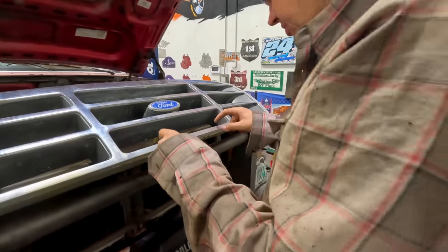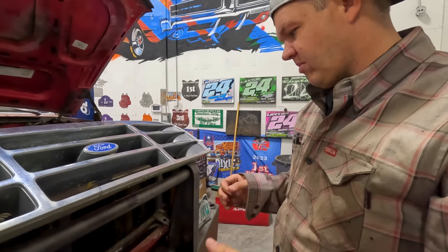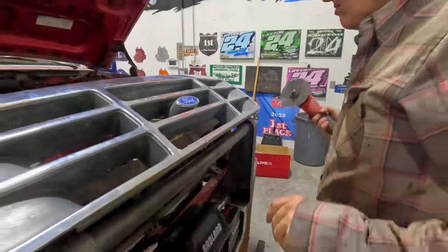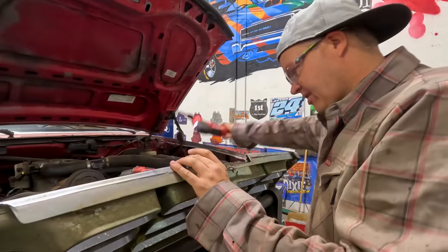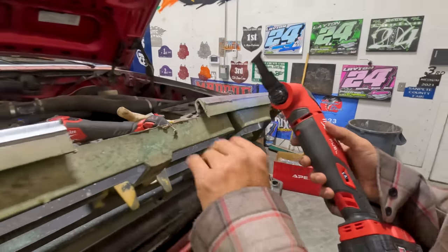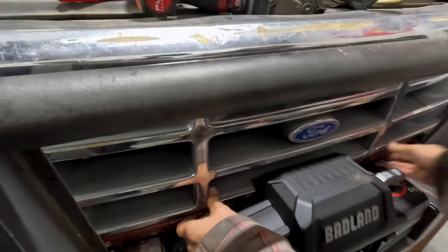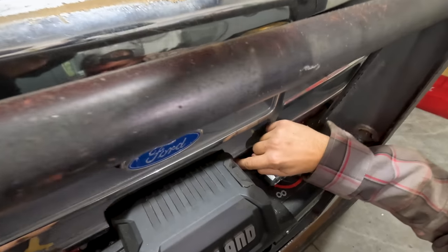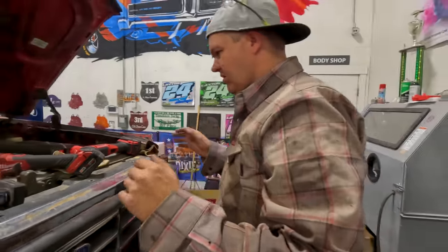Now that I've got the lower vanes notched, I'm going to start notching this but only an inch at a time — take it here, go in an inch, cut it, then test fit. If I have to take more I'll take more, but I don't just want to make a big humongous hole. I'm going to double-check I'm not cutting too deep. I think I'm going to cut through this bottom one because it's pretty flimsy anyway. Test fit — I think we got plenty. Actually I've got to take it a little bit further — just a quarter of an inch more on each side of that grill. It's going to be an expert fit.